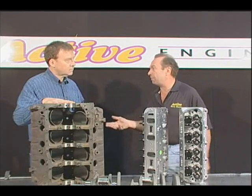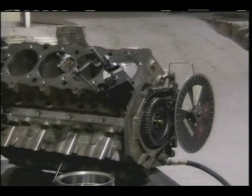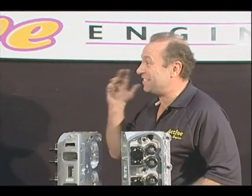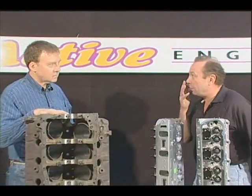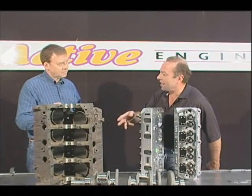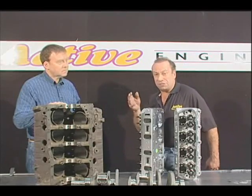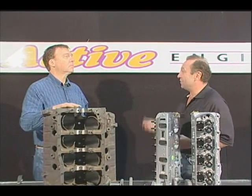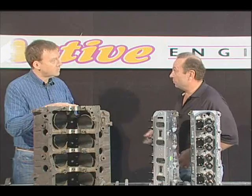Another thing that we do here at Active Engines with any performance engine — as opposed to just putting the camshaft in, putting the chain set on, and lining up the marks — we use a degree wheel. A degree wheel allows us to degree that camshaft and tie it to the crankshaft at exactly the right moment, closing the intake valve at exactly the right moment so that we trap as much of that air-fuel mixture in the cylinder as possible. If done with a degree wheel, it usually takes an hour and can take several hours. Everything is scrutinized; the engine is hand assembled by one guy. Even things that are overlooked — like at a lot of other shops — is a pushrod. Just because your valve train book says this is the pushrod to use doesn't mean that it is. The last thing I order for any engine is a pushrod. Use a geometry checker that will actually tell you if the pushrod is too long or too short. If the geometry is wrong, your entire valve train will not last as long.